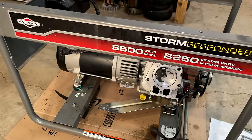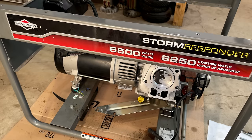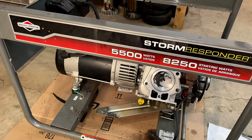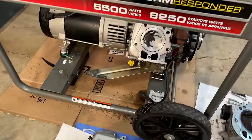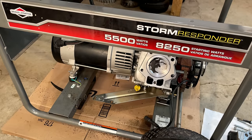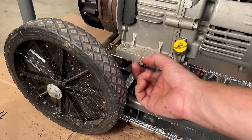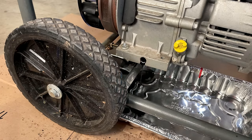But for now, I do want to pull the drain on the crankcase. I want to see if there's any oil in there at all and drain out whatever's in there and get some good fresh oil in there now before I get this put back together, because once it's together, I get a little bit anxious and I want to hear the engine run and I don't want to do something stupid like start it without oil. Not much. So I'm not sure how this engine didn't blow up, but at least there's no water in the crankcase.